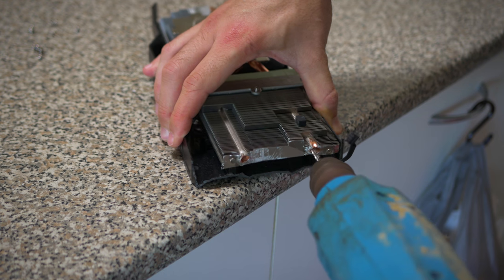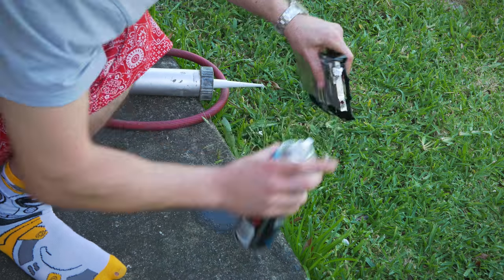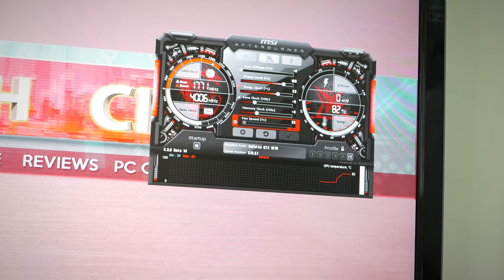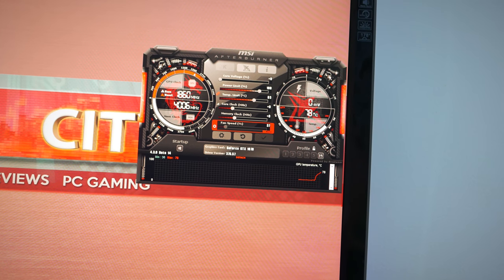However, now that I'm back with my tools and the like, I decided to fill the heat pipes with initially hydrocarbon and then quickly seal it. This initial experiment failed and the card was still hitting the thermal throttle limit quite quickly. I did a second round, but this time with oil in the pipes. Same result, the two heat pipes on this card were just not coming back to life.